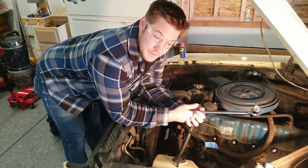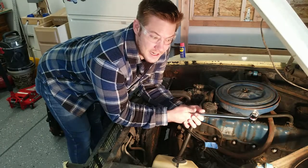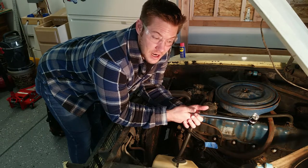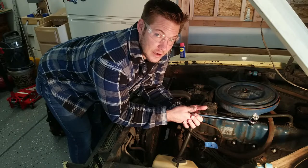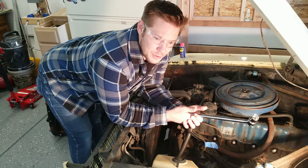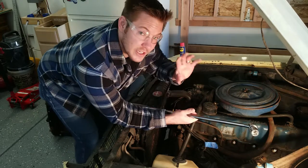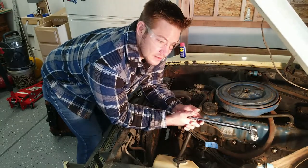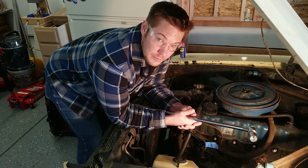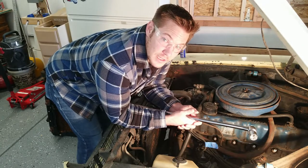That didn't break free. All I did was tighten the bolt, and I don't want to go too far because the worst thing that could happen is I could exceed the bolt's torque limit and snap off the head in the crank — then it has to be drilled out. I may actually end up backing that bolt off a little bit because I don't want it over-torqued, creating too much friction on the main seal bearing on the crankcase. Time to move on to slightly more drastic measures.